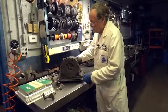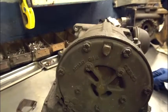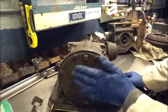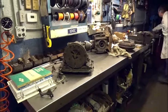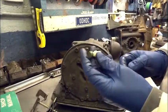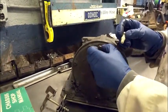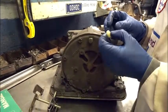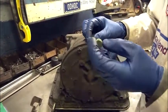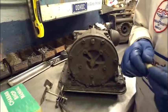The next thing to look at is the vent on top of the transmission — a little metal cap, crimped over, that lets the transmission vent. This style is used on 1960 through 1966. In 67, Chevrolet went to a less expensive plastic vent used on a number of GM cars. Instead of the crimped metal piece, there's simply a hole in the front of the transmission with a plastic piece that slides into it. A plastic vent or a hole where the vent should be is a pretty good indicator it's a 67 or newer transmission.